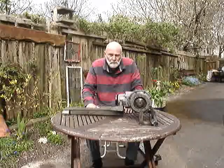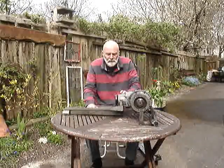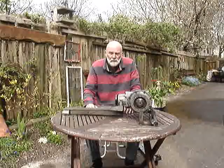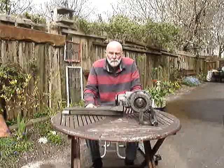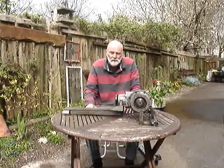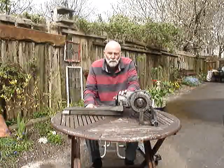I did some small experiments with various alternative mountings at the front here. I used a 50-millimetre diameter rubber mounting underneath the nose of the box, which was fail-safe, with steel plates on either side. I didn't even get to the end of the road before it turned one of those steel plates into a mushroom. The force lifting this is enormous.